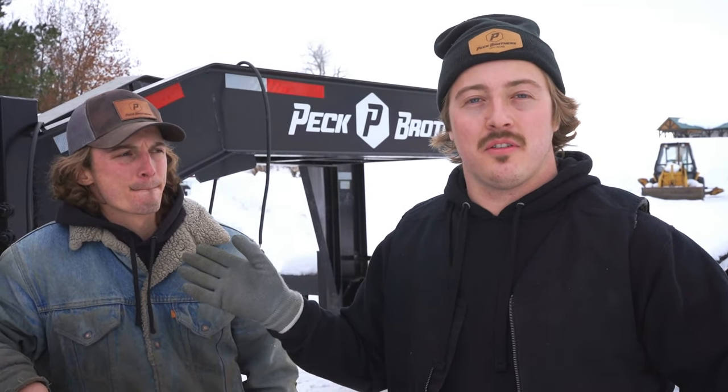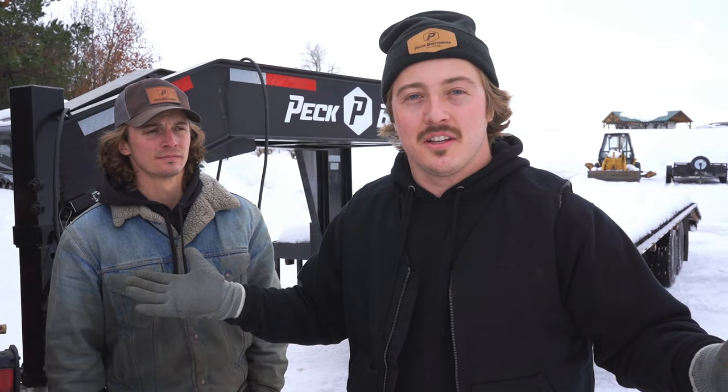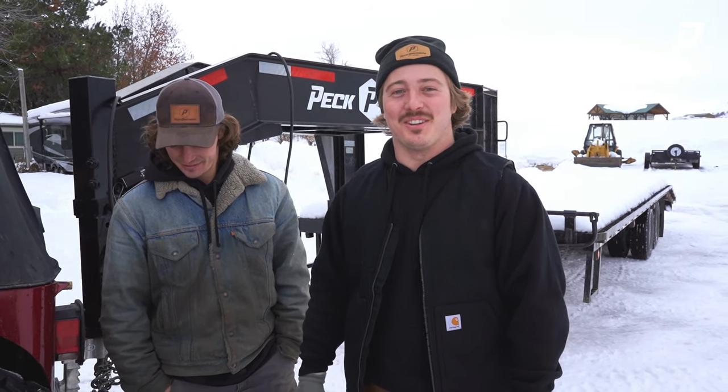Theoretically, just talking theoretically, this motor came out of a Chevy 3/4 ton truck. I guarantee they're rated for 6,500 pounds to tow. We've got a 6.0 motor, a 4L80 transmission, and an Atlas transfer case. And these are Super Duty 1-ton F350 axles. So this thing is literally built to tow this, in my opinion. Yeah, those parts are. Other than the suspension, it's perfectly fine. And the bumper. I think we're probably going through like 3 gallons a mile of fuel too.